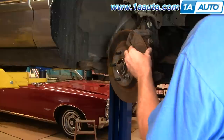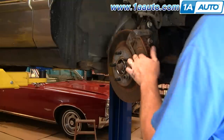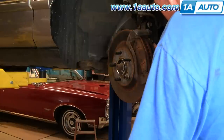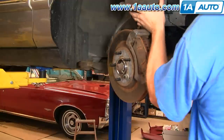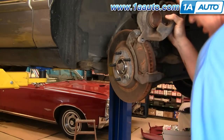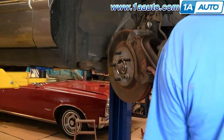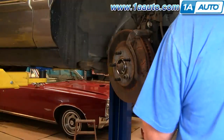Now your pads — obviously I'm not putting new pads in because mine are fine. What this vehicle really needed was a new hub. Put the pads back in just by placing them like that. If you're putting new pads on, you'll need to compress the piston — you can see my cylinder is out of the caliper some, so you'll need to put that cylinder back in. You do that with a large C-clamp. Push that piston back in. You may also want to check your brake fluid — if it's over full, you may want to remove some of the fluid so it doesn't leak out.